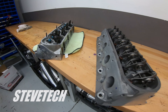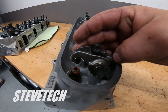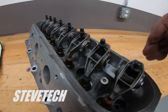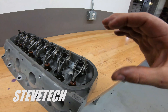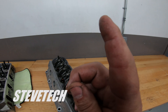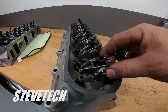Here you've got a valve that's a set height, the rocker arm is a set height, and you need to have the proper length push rod — period — in order to load it. Why this is a little bit better than your typical stud mount is that this stand and rocker arm system all bolts down. It's clamping together and has a lot less tendency to move — it's not sitting on a post going like this. When you bolt this down, it's very hard for this thing to move, so it's much more rigid.